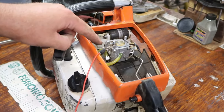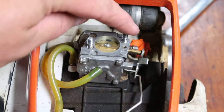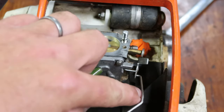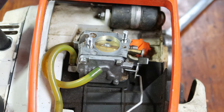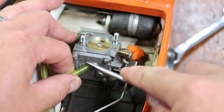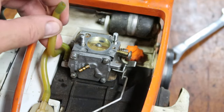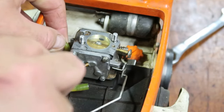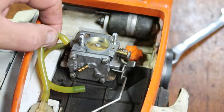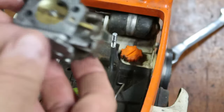I'm going to take the carburetor off and clean it — it's a very simple procedure. These are all built about the same way. After you take off a couple of nuts, it will just slide off. There's usually one or two gas lines — just loosen those, and as it comes off you'll be able to disconnect the linkage. While taking it off, I always check the lines — these are very soft and rubbery like they should be. Make sure that if lines have been replaced, someone used actual fuel line, as non-fuel line will melt.